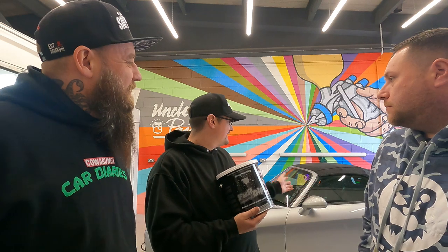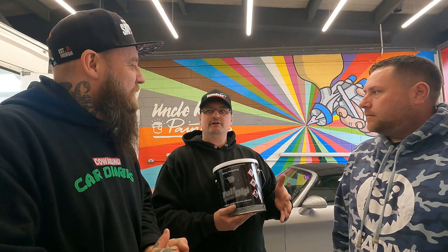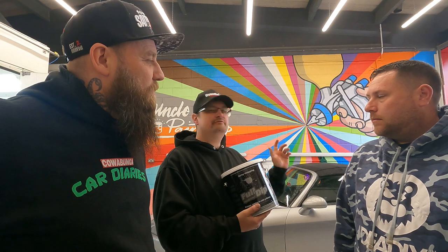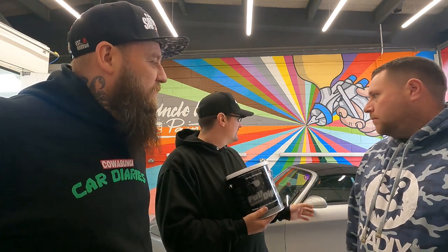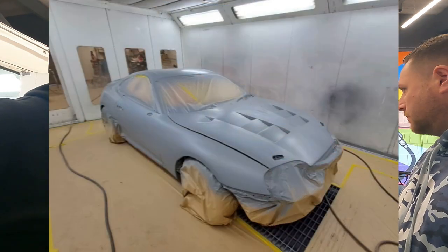It's removable like a wrap, and I think the turnaround's quicker than a traditional vinyl wrap because that takes a while. We can probably turn around a clean car fairly quickly. We're actually taking more parts off than most people — we're treating it more like a traditional respray rather than a standard wrap. They suggest you can mask a lot of stuff up, but we don't want to do that. We want to remove stuff — we don't want any lines anywhere. Lights out, side repeaters off, bumpers off — do as much as we can. Take the waist moulding off, get the handle out, the mirror off.